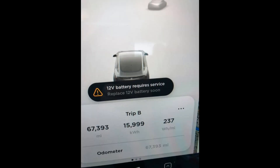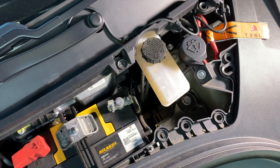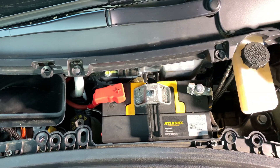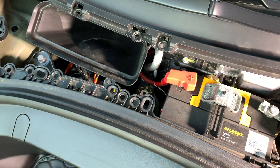This is an example of what the 12-volt battery warning would look like in the car. If you see this warning, I would recommend getting the battery replaced by Tesla within a few days. Sometimes you may be able to get a week or two, but it's probably not worth the inconvenience. From what I've seen online, some people have had to replace their batteries at 45 to 50,000 miles, so you should get around two to four years of life out of the 12-volt battery. One tip for improving longevity is to turn off mobile access.